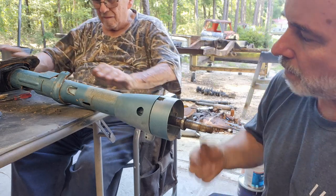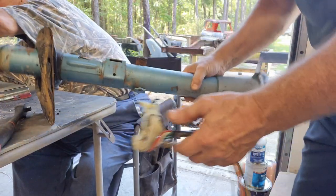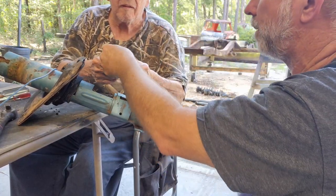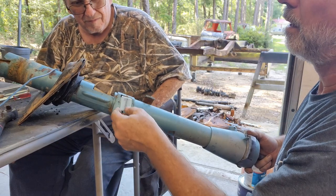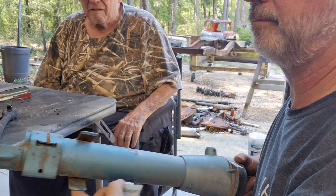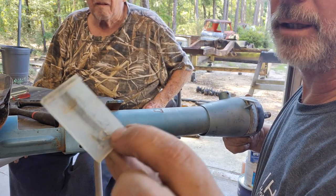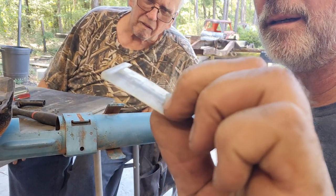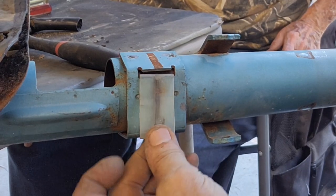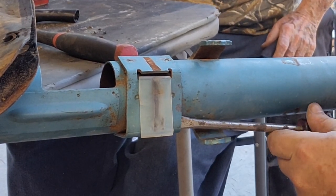So I think at this point, there's a piece of plastic that goes across here. Yeah, we also pulled. Right here, you can't get these, and they're very brittle apparently, Nick says, on my vintage Thunderbird, and it hooks. See this area right here? Come a little closer. All right, so you see this end here, and then you got the hole here. And if you look at this, you got a hook right there. And then you got the push-in tab right here. And then this will just simply hook on this end and then push into that hole. To get it out, we had to come from underneath, like Nick says to do on his, and pop.